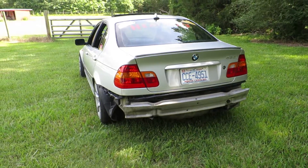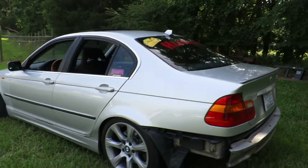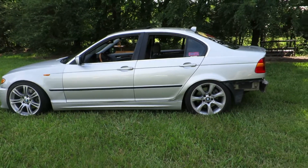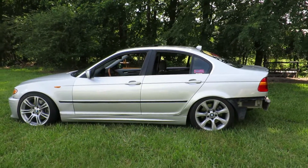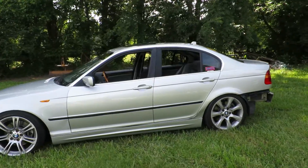The rear subframe bushings I just haven't gotten to yet — I have a subframe sitting out here, I just need to order them. Especially with how many events I'm doing now, these cars are notorious for tearing subframes. This one being a sedan is the strongest chassis you can get for an E46 — about 18,000 newton meters of torsion strength. The next closest 3 series is 12,000, and that's a coupe with no fold-down rear seats or sunroof.